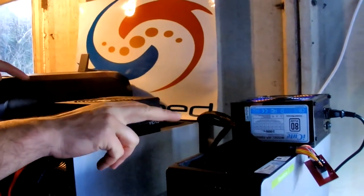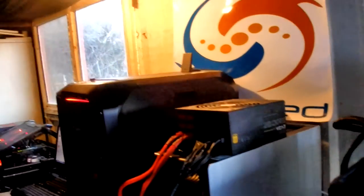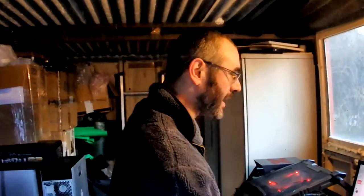If you're wondering why I've got separate power supplies on these — it's because the power supplies that come standard with these servers only have one 6-pin power connector. So by simply getting a little switch you can plug it in directly to the graphics card and run it separately. Plus these power supplies are more efficient.